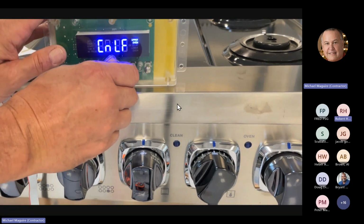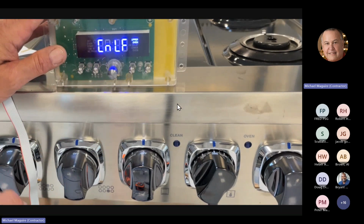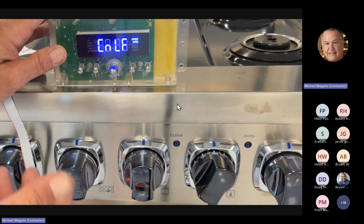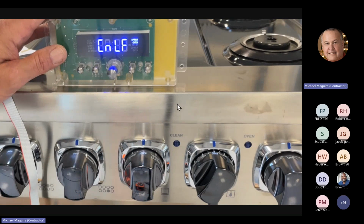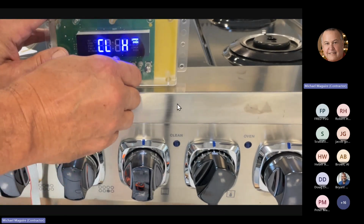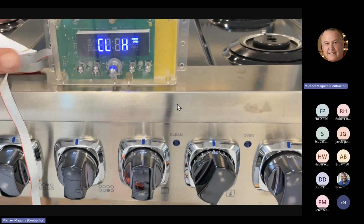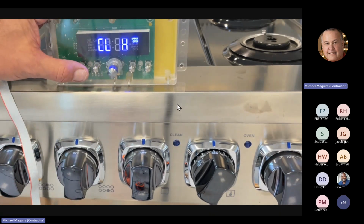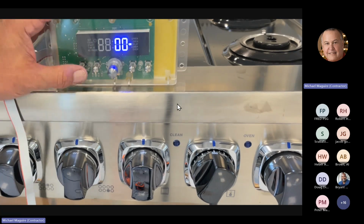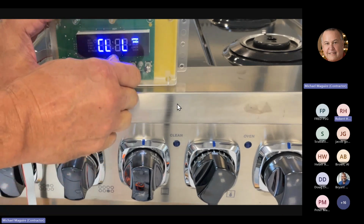Now, so that's high and low forward. We skip the next 2 tests, which are the fan going backwards, because they want to allow some time for the fan to stop. So the next test that we go to is the cooling fan. What this will do now is turn your cooling fan on. Now I can hear the fan running. You can tell if the fan's running, and then I can switch it to low speed.